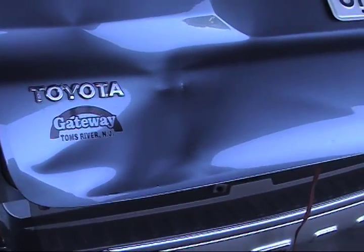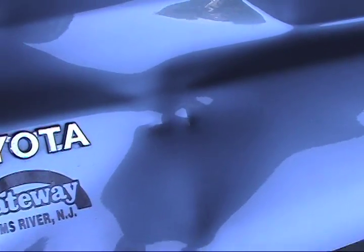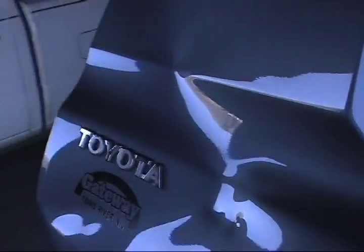It is a big dent and it's stretched, but if you bring it up and balance out your pushes with your tapping on top, you can minimize the stretch and leave it in one spot.